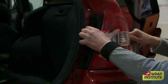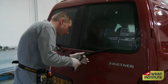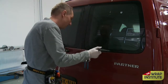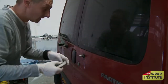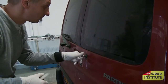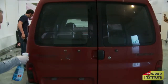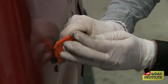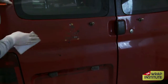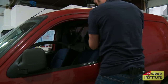And if you miss it, it either goes underneath the film. Or if you don't miss it, you have to clean the car twice — not good. Always just want to clean the car once. Windshield wipers are good to remove because there's always a lot of dirt underneath those, especially if you're just changing the color of the car — or at minimum get underneath those windshield wipers. If you're removing any emblems, obviously take off the emblems, and if you're going to use adhesive remover, just watch out for it dripping onto the rest of the car. Any kind of molding — lots of dirt underneath the molding.